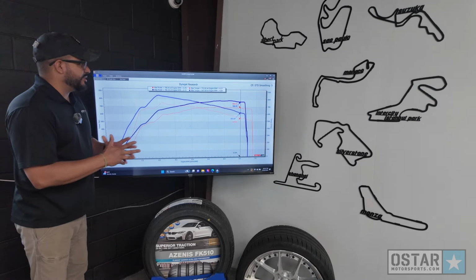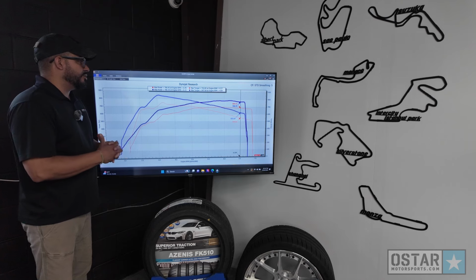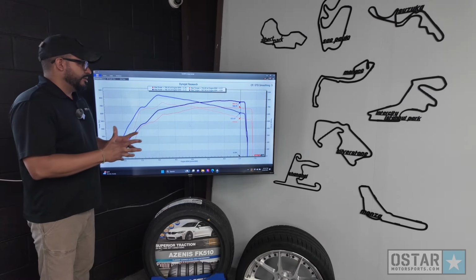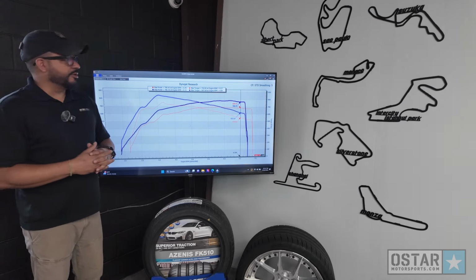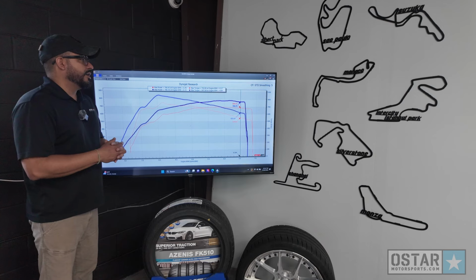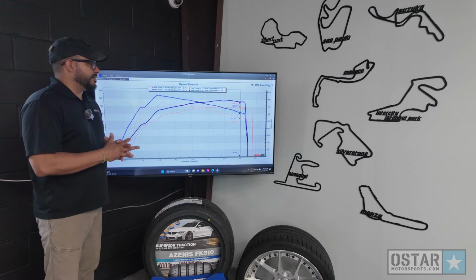So definitely substantial gains, 86 wheel horsepower from a stage 2 to a stage 3, basically switching the turbo is phenomenal. And to think that it's on pump gas, it's actually pretty substantial. Now, imagine what this thing would make if you added a methanol kit, or once they come out with an ethanol tune, it should make substantially more. Granted, we don't know the limits of the stock motor, but that's something that we're going to see as these builds progress.